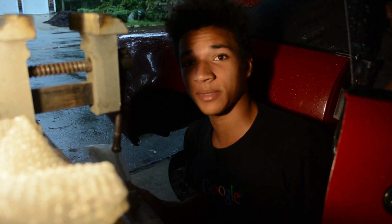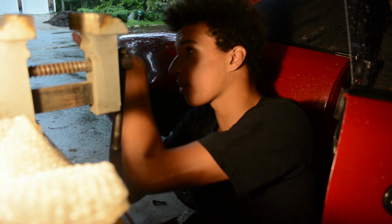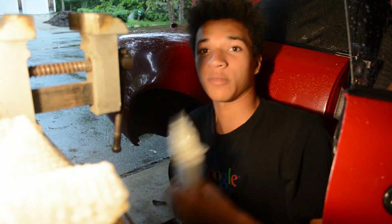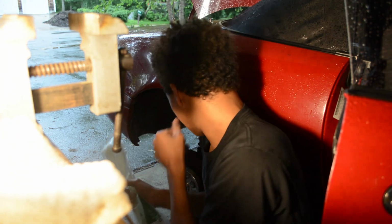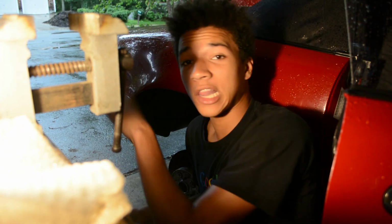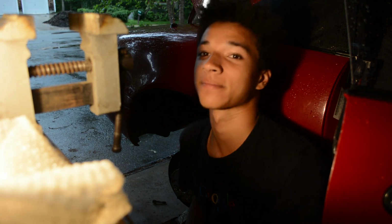So what we're going to do, because we can't get the coilover out, is compress it with another jack, put it all the way to the car onto the suspension. The spring will compress itself. We will put very large zip ties onto it, hold the spring, and then we'll be able to lower down the jack. It will be nice and low. The lower control arm will clear the strut. We'll be able to pop it right out without cutting the spring with the angle grinder.